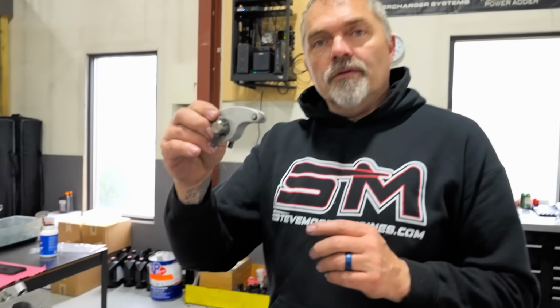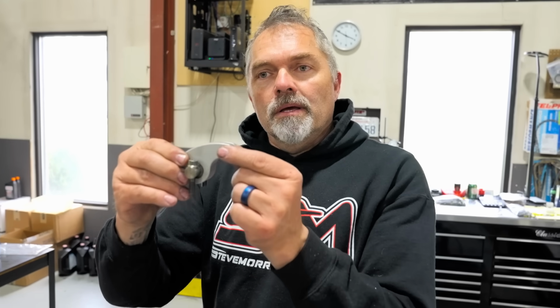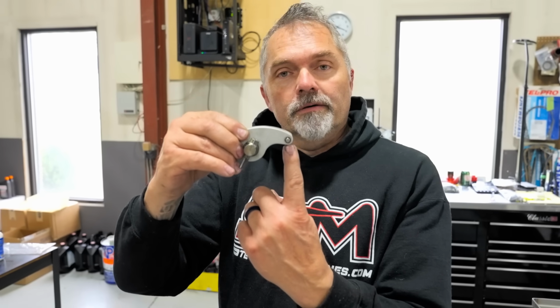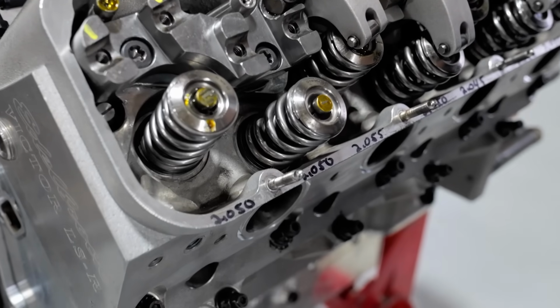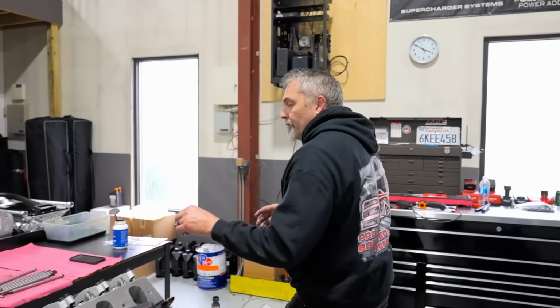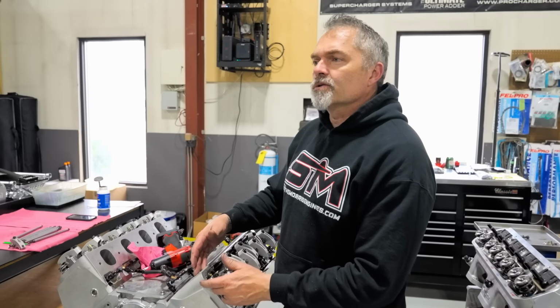So in an ideal world, middle of your lift, it is right dead in that middle range. Anywhere else, it's just slightly off to one side at the start, slightly off to one side at the end, but right dead in the middle at middle lift. That's what you're wanting to see. So you raise your rocker arm stand height with shims to the correct dimension so it will have a really nice, correct sweep pattern, and then measure your push rod where it's at. All right? So that is how you do all that. Like I said, we'll have a little more detailed video when the Pontiac comes out, but that's a good illustration. You understand what the shaft is? All right, yeah, very good.